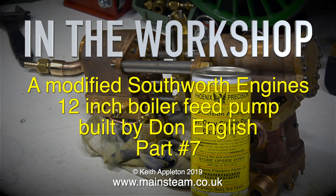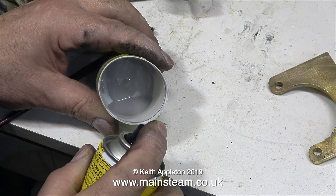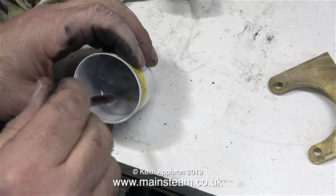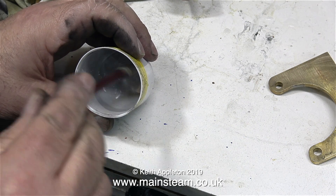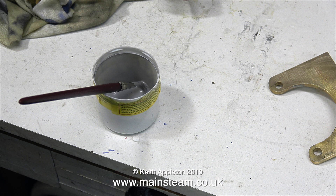This is Phoenix Precision Paint's grey single pack etch primer. But I'm not going to spray it, I'm going to brush paint it. So the first thing to do is to spray some of it into the cap. Then it's a good idea to leave it for a while for a couple of reasons: one is it's just been sprayed, so it's very cold; and the other reason is to just let it evaporate slightly so it becomes thicker. It's a good time to make a cup of tea, which is what I did, and then I came back to a slightly thicker version of the paint.